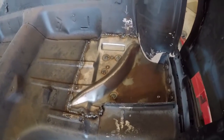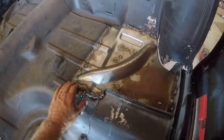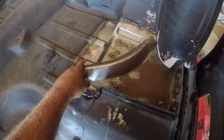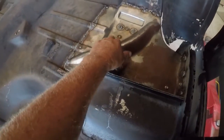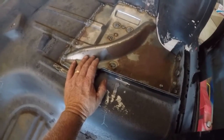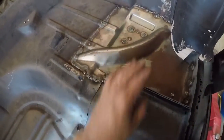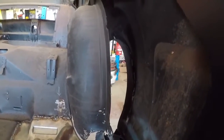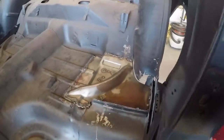Here's that piece, part of the torque box on the left-hand side. We've just welded it in now. I've still got to go to the other side because I've got it overlapping. You can see the tech holes where we had tech screws in. With the plug welds back onto the chassis — remember the chassis plate that was in there? — all I've got to do now is flip it over and stitch on the other side as well, so that's all done. Now we've got the inner guard too, which is going to go back up into that gap there. We're progressing nicely. We've put the plate back inside the door, which is the one back up in here. We've got the cable glands through it — that's been done now.